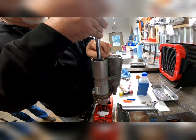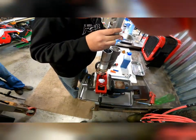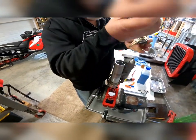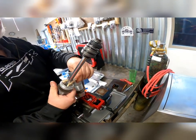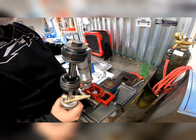There's a snap ring in there that holds that seal head, which also has a bushing in it. And out it comes. That's your valve body — the valving of the shock. And no, that's not a special tool, that clothespin. You can just get any clothespin.